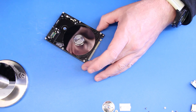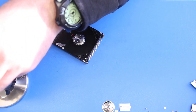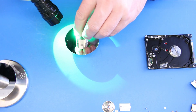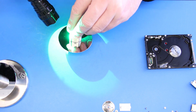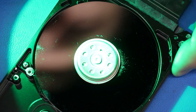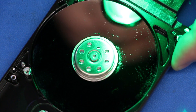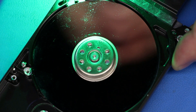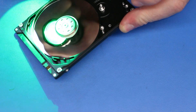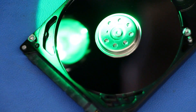There are two different types of decontamination. One where solvents have to be involved, and another where solvents cannot be used. If we're dealing with oily stains — for example, if the motor failed — or fingerprints like you see right now, solvents have to be used to dissolve the oil. If it's dust from platters, the preferred way is without solvents, because solvents will mix with the dust and be very hard to remove, potentially causing further micro damage to the surface.